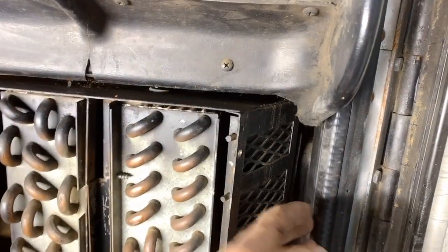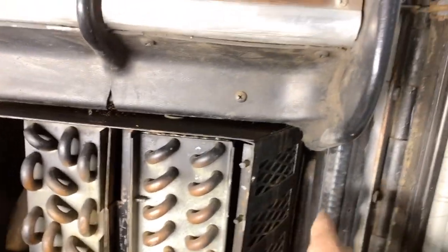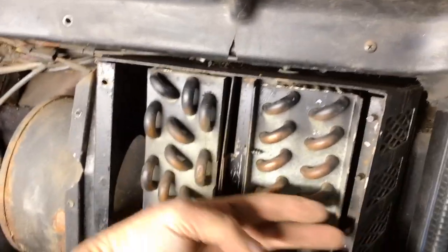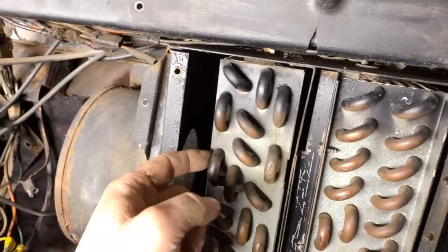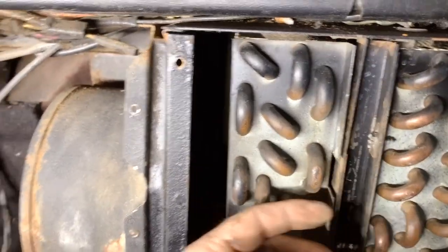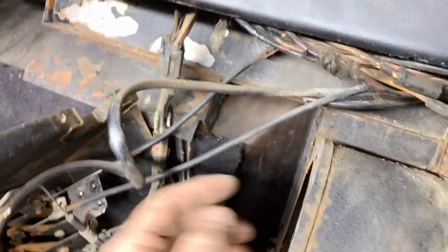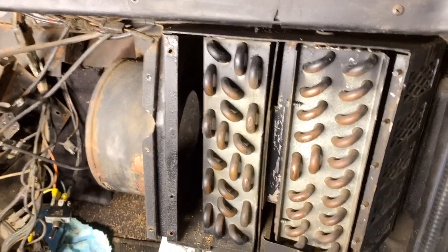Now the way you get warm air in the cab is you got this outside vent there, and again there's a flap on there as well, controlled by one of your other levers and this cable, and that flap's either going to let in fresh air or close it off and just circulate the air around the cab. Then when the fan motor's going, the fan's spinning that little wheel, and it's going to pull air through here, past the hot coolant on this little mini radiator, and then blow it up the vent. Depending on which way you've got this set, it controls a flap that's either going to send heat out this way to your feet, or upstairs to the window. And that's basically it. It's a very simple system, and that's how you get warm air in the cab, or cool air in the summer.